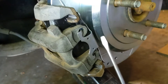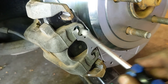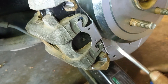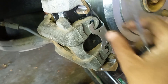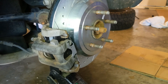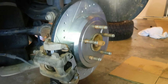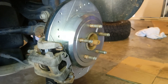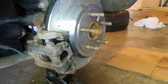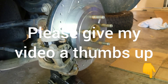The easiest way I find to get the rattle clip back on is to put it on the outside, get one side hooked in, then use my screwdriver to wedge it in and pry it until I get the other side down — then just push that last piece in and it's rock solid. That is how you change out the rotors and brakes on the rear of a 2013 Jeep Grand Cherokee. Put the tire on and do the brake-in procedure. I've got all the materials you'll need below with links. Please give me a like, subscribe, and let me know if you have any questions or comments.